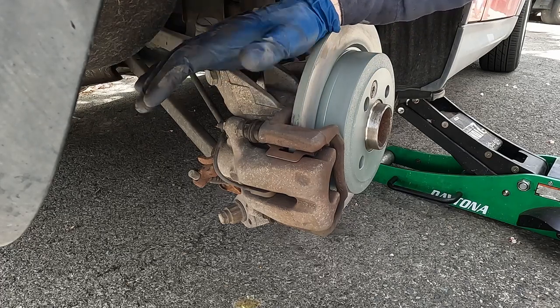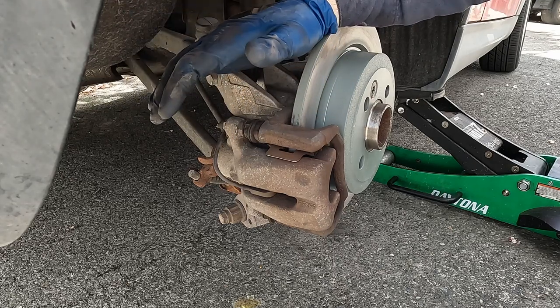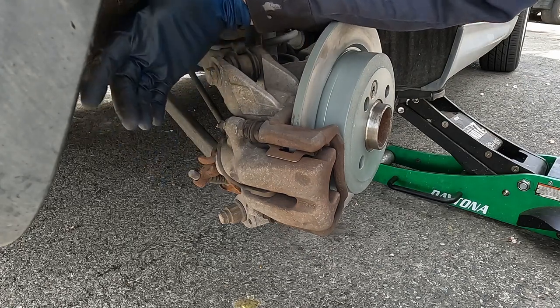Before going to the other side, I like to pump up the brake pedal so I don't forget before a test drive — the brakes are already pumped up and ready to go. The other side is done very similarly; you just won't have a brake pad sensor but everything else is the same. Now take the vehicle for a good test drive to burnish or break in the new brakes: bring it up to about 30–35 miles per hour, come to a good solid stop without locking the brakes, let off, accelerate again, and repeat that four or five times. I'll have a link in the description for all parts and tools used, and if you need to do your front brakes, click that video. Thanks for watching.